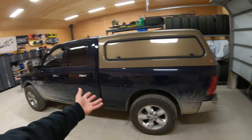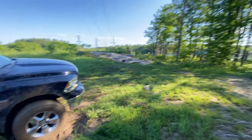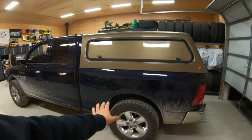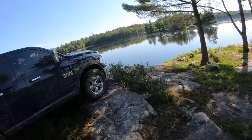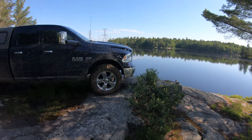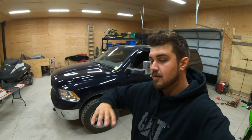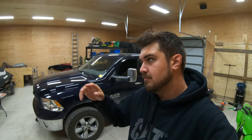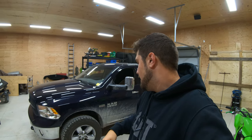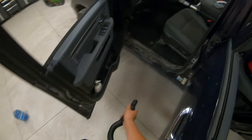As for the actual suspension of the truck, right now we have helper bags from Airlift in the rear. One of them is blown right now and I'm getting that fixed on Monday, so the truck sits a little bit lower on the left side, but it drives fine. The truck is currently sitting on 34.5s — I call them 35s, but really they're 285/65/20 BF Goodrich KO2s. I'm also running a two-inch front level and two-inch spacers all the way around just to bring the front up and give the truck a bit of a more aggressive stance.